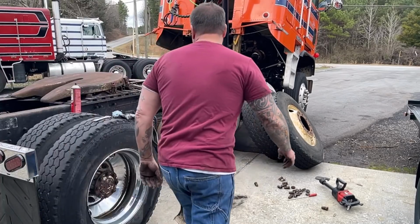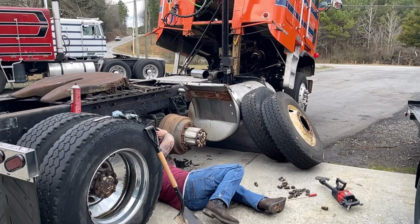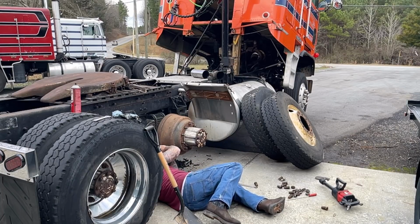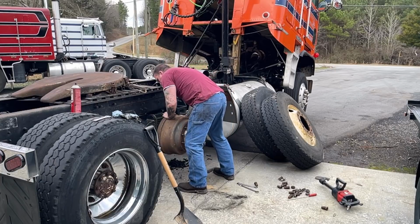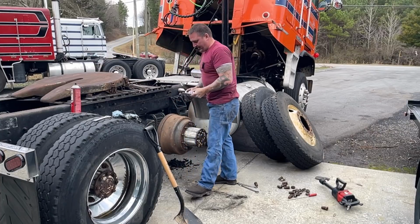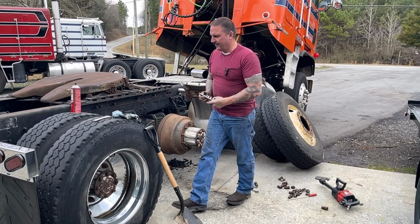All right, so there's a little cap with a spring, and it keeps the slack adjuster from backing off. It's like a one-way check ball, and you got to take that out, and then that takes the pressure off of the little check ball, and then you can loosen the brakes. So anyhow, don't forget and leave your little ratchet on there, and it's a square drive 5/16.